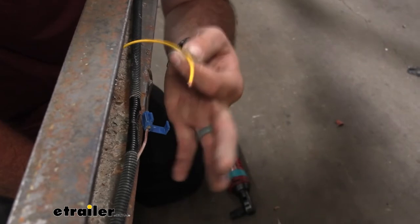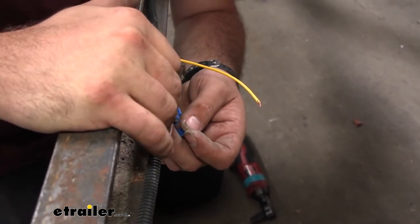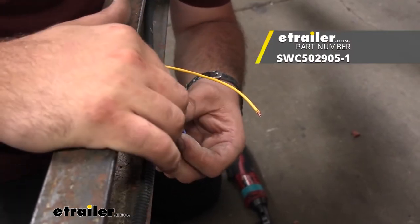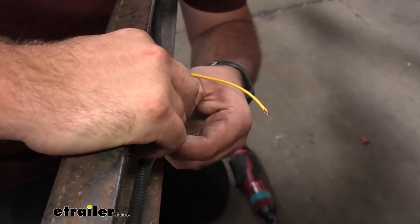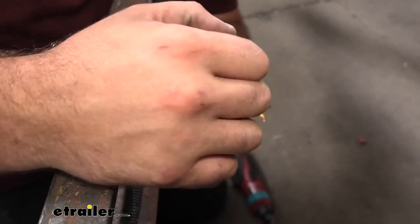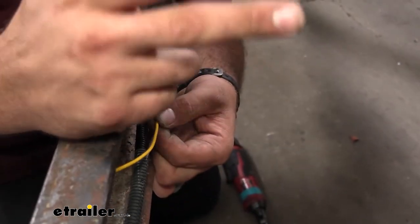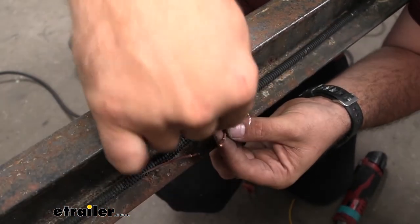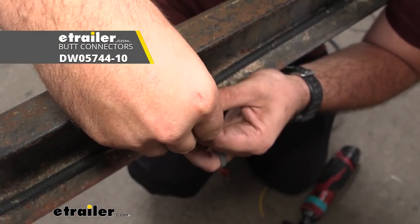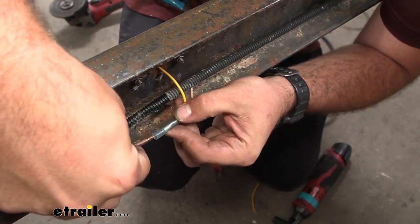As far as the wiring portion goes, it's going to be really simple. Depending on how yours was previously attached or if you're adding a new light, you're going to want to find the connection where it goes into the brown wire, which is your running light circuit. That way when you have the running lights on, these clearance lights will come on. Because this is exposed to the weather, we don't want our wires to corrode. I'm going to cut our brown wire and use a heat shrink butt connector so when we have this tied in it's going to be nice and sealed up and watertight. I'll take our yellow wire from our new light, twist it together with our brown wire on one side, get our heat shrink butt connector in place, and then tie back into that brown wire on the other side.